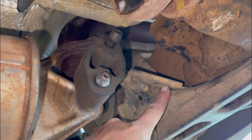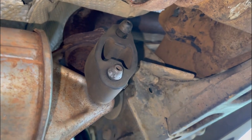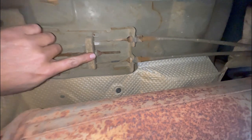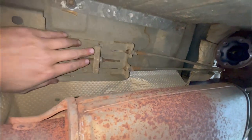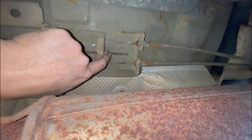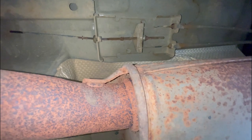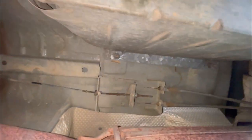This is the only exhaust hanger you need to remove because this bracket here is actually welded to the frame — you can see the subframe. I had these off the other day when I was doing the exhaust, so just slide the rubber off at either the top or bottom, doesn't matter. One other thing I forgot to mention — we need to disconnect the handbrake. I completely forgot about it. It's really easy; this whole assembly is attached to the diff. It's your cable here — this piece comes off. There's just a 10mm nut here covered in gunk — it's deep, so if you can get a long socket on there it's a lot quicker.